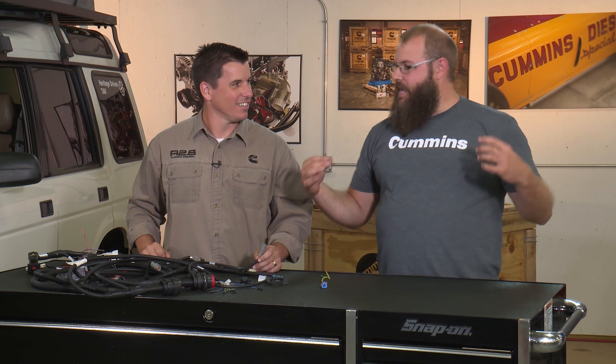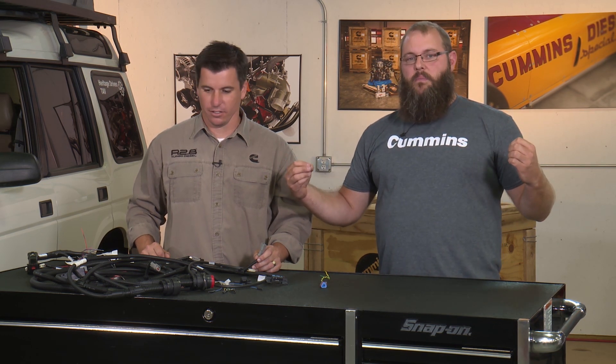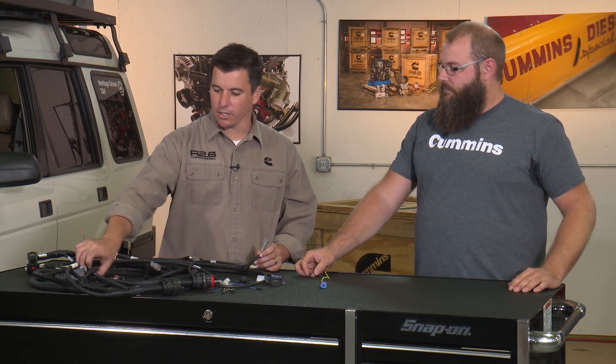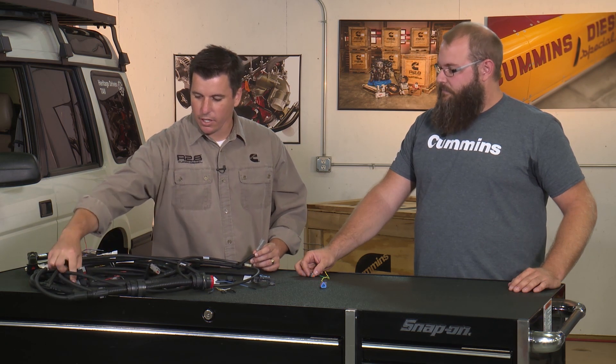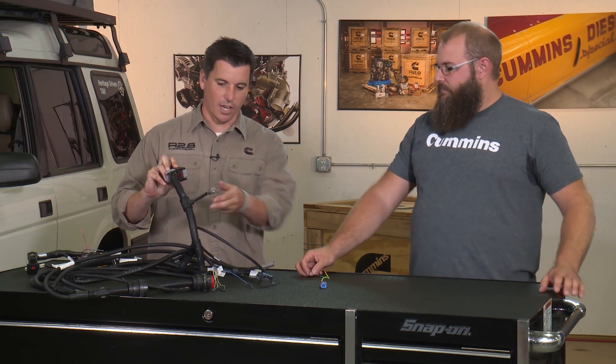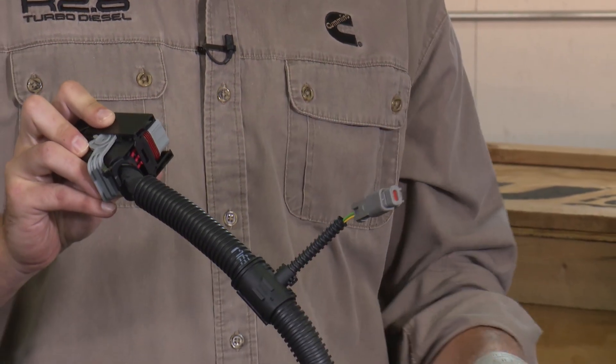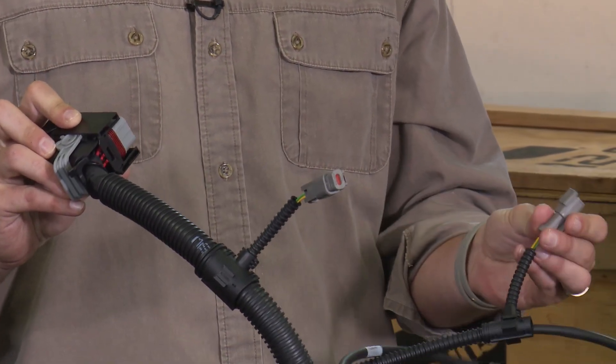What they're doing is taking all that reflection of complicated data coming through the CAN bus and stopping that reflection from happening, thus ensuring good communication across your CAN bus for all your devices. So as tempting as it may be — here's your ECM plug — do not tee in by getting rid of your terminating resistor right by the ECM or the one on the inside of your harness.